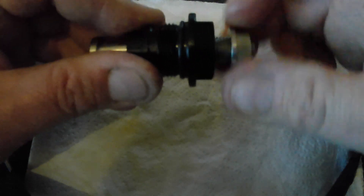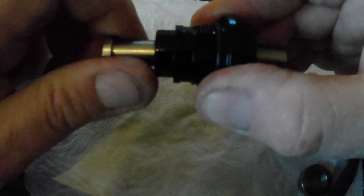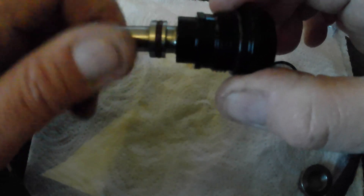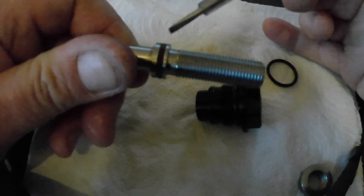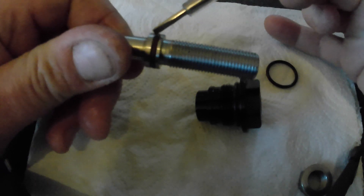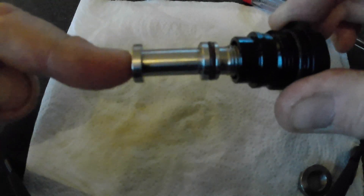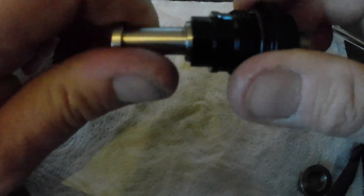This is a lot simpler. It is made up of your lock nut, and then the outer housing is threaded to allow you to increase its length. There is another rubber seal on the inside just here, which stops oil coming out of the engine this way. Your adjustment is basically to screw this in or out to make the foot here engage with your cam chain follower and apply pressure so that you can set your cam chain tension how you would like it.